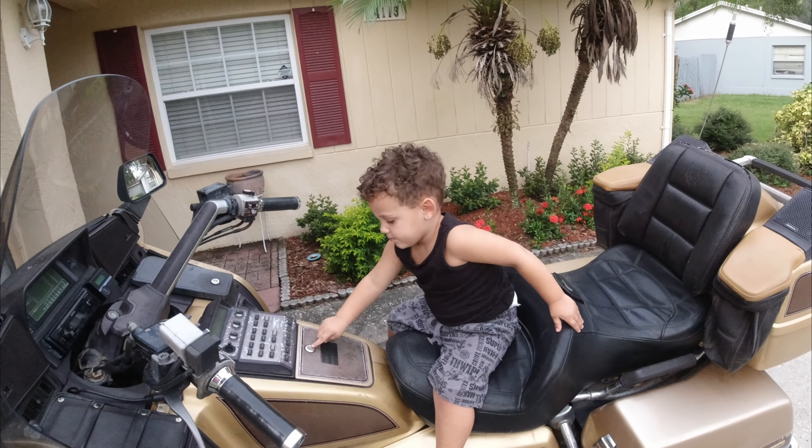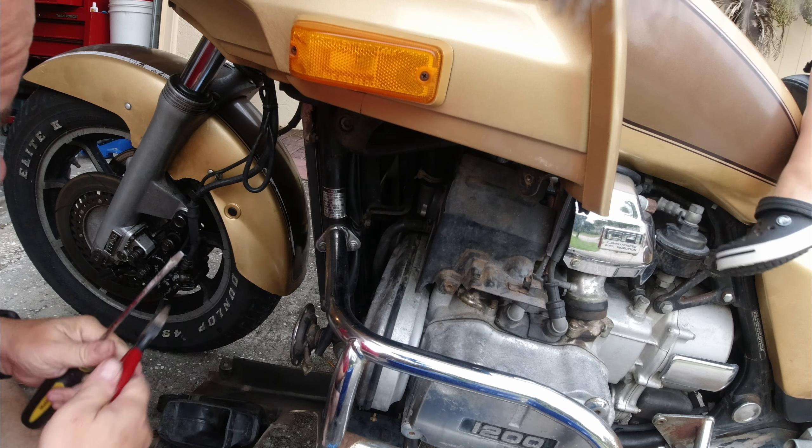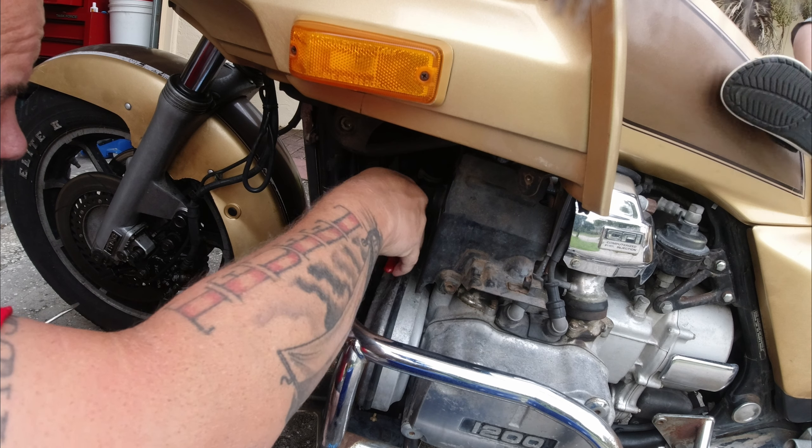Welcome back — today's Tuesday. I actually intended to ride to work today and then remembered this morning as I was getting ready to leave that I never put another clamp back on the radiator hose. I just used two zip ties, and while I was okay with that for the little test ride I did on Sunday, I didn't really want to risk it while riding in commute traffic, which can get the engine hot. So I'm just going to slap a clamp on here real quick. Wife's at the grocery store, I've got the baby. I forgot I had to take that fairing off in order to get in here and get these zip ties off.